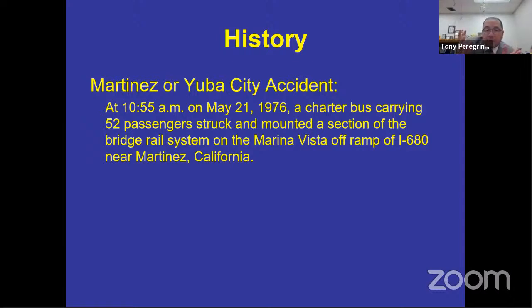So air starts to leak. It's not so bad where it continues to leak. So that compressor is kind of working throughout the day, so that if you're losing air because of the leak or you're applying the service brake, it's still building up air, but it continues to fight building the air because of the leak. So as the driver's driving down the roadway, a light and buzzer comes on. That happens to be the low air warning device that comes on. In those days, the low air warning device was required to come on between 55 and 75 PSI. There was a bottom and a top limit for the low air warning device.